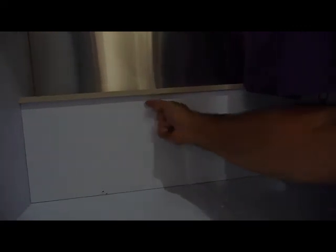Alternatively, another way to route the wires to the fridge is to take them through the underfloor chase, and then directly backwards. You'll come up in your 27FB — I've opened up the closet here. There's this piece of structure right here that I'm touching, and this comes out with a couple screws. You can run the wires underneath this little shelf, into this hollow back here, and then over in that direction. Just drill a hole through the plywood — on the other side is a bit of metal — and that can go into the fridge area if you don't want to go through the floor.